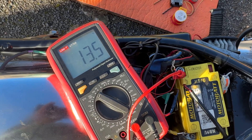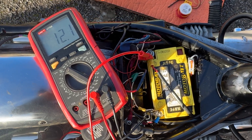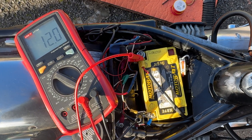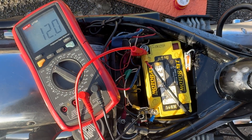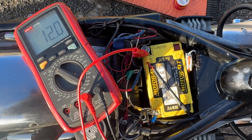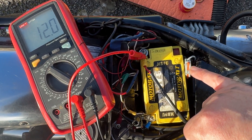I've absolutely sorted the problem. Stripping out the airbox has given me the opportunity to look at the condition of this loom, and many of the connections are woefully worn and tired, using old Triumph bullet connectors that simply won't wash. So for me now it's going to be a revision of the wiring from the AC circuit up to the Podtronics, and there's certainly some tidying up to do — including a loose gray wire I'll need to trace on the wiring diagram.